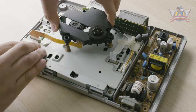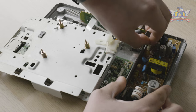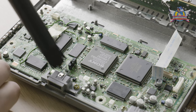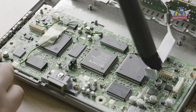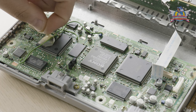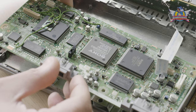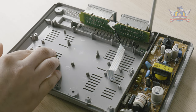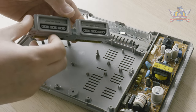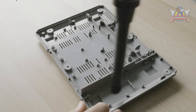Now with that done, it's time to unplug all the cables to get to the center of the unit. The PS1 is a pretty simple console once you get the hang of it. Moving on to removing the metal plate, revealing the heart of the unit — the PCB with all its video and audio chips. Blown the dust away again, and there is a mod chip installed in here. I have no clue which version, but that scotch tape has to go. I also remove the PCB to get to the other components that need cleaning. The controller ports and the power supply unit are their own compartments, and the PSU is an absolute breeze to uninstall.